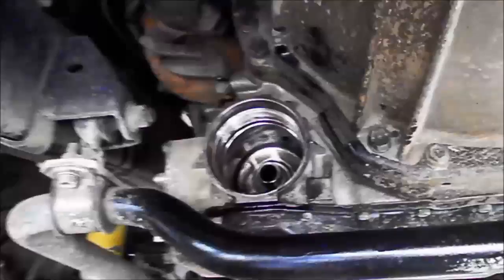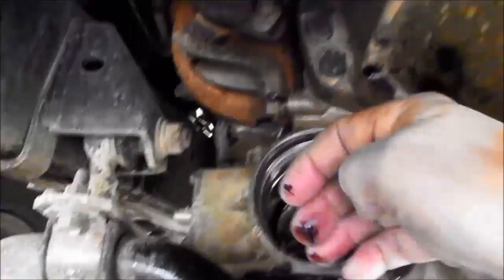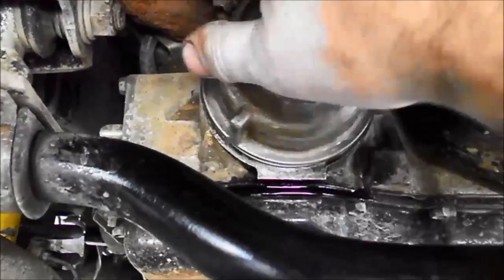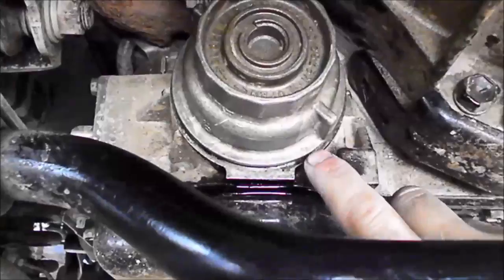We've cleaned the housing a little bit — we use newspaper. Make sure it's newspaper that won't come to pieces when you're wiping it in there because there are little sharp edges. You can see the little tube inside there that locates on the other side of the filter. We just place that in there and slowly do it up until the o-ring approaches the groove, then slowly do it up. It'll get pretty hard and we do it right up until it bottoms out on the housing — you don't have to overdo it though.